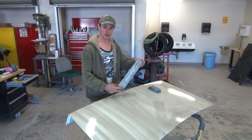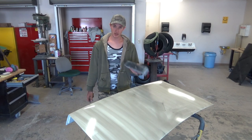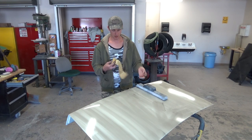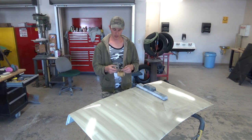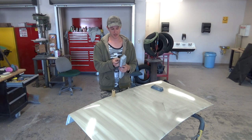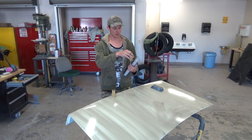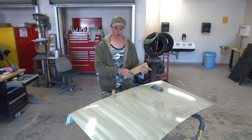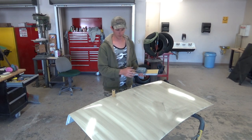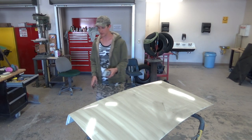You can make your own sanding blocks, but I really like these Durablock kits — they're about $50 from most retailers. Use the block that works best for the job. 150-grit is a great use-on-paint, use-on-primer, use-before-coating paper. It cuts fairly quick, lasts a decent amount of time, and doesn't leave excessively coarse scratches that future coatings can't fill. The scratches you see in here are probably 80 and 40-grit — I want to get those out so our primer doesn't have to fill them, which makes for a better quality product.